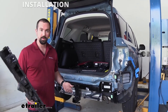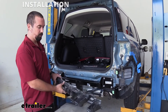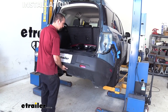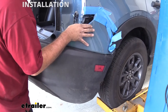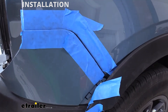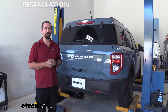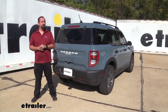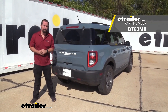The hitch is officially installed — really all that's left is to put everything back together in the reverse order that we took it off. Put your fascia support back on, and when you're putting your rear fascia on itself make sure you plug that plug back in. From there, take your time with your plastic clips and it all should go back together perfectly and you'll be ready to use your hitch. With our rear fascia and taillights all reinstalled we are ready to use our hitch. Hopefully this installation helped you get through it step by step. That was a look and installation of the Draw-Tite trailer hitch receiver on a 2021 Ford Bronco Sport. Thanks for watching.